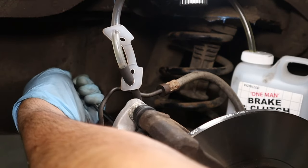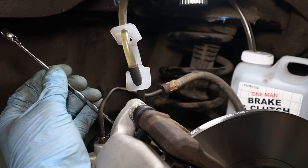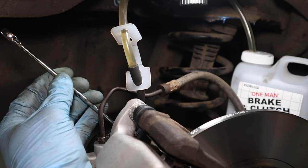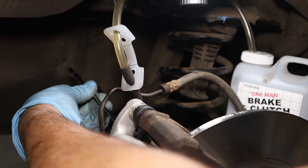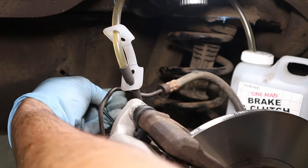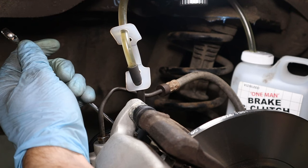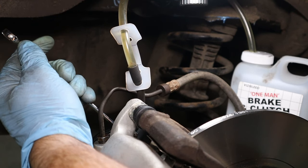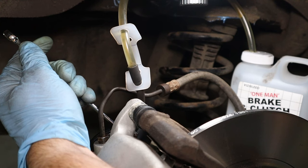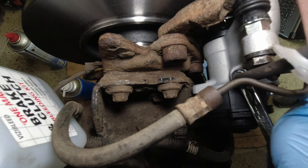Right, hold down. And here comes brake fluid. Good stuff. Watching for these air bubbles to go. Pinch off. Okay, 5 times again. Down and hold. Do not seem to be seeing very much air at all coming out there. Okay, up.